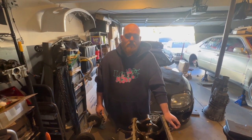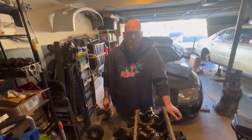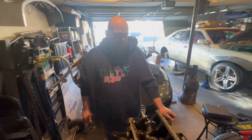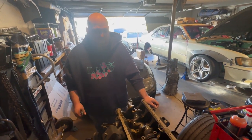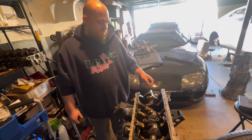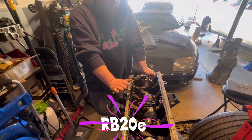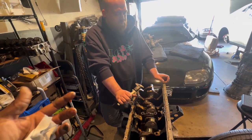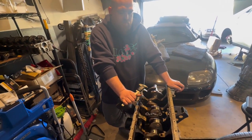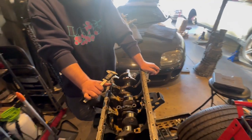Somewhere around that ballpark. We're gonna use RB30 pistons just because of the way they're cut for the single cam, so we're going single cam — that way we can use the RB20E rods to make it happen. We're making progress; it's slow progress but we're getting there. These blocks are so plentiful, why not use them? I want to make sure that we can reuse this block if you have the resources to build it. We talked about this last night, trying to figure out different ways to make it affordable. Everything fits, everything looks good.